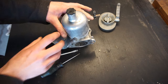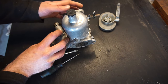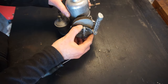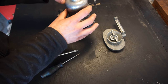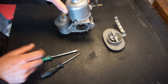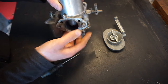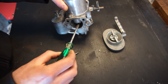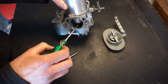There are two main adjustments we're going to look at. First is the amount of air the carburetor lets through — that sets the idle. If you have multiple carburetors, you have to balance them out; that's why you use the synchronizer to measure airflow on each carburetor and make sure they're the same. Then you need to set the mixture — how rich or lean each carburetor is. On some carburetors you can use a lifting pin on the side to lift the piston slightly for a test, or you can use a small screwdriver in here to carefully lift the piston.